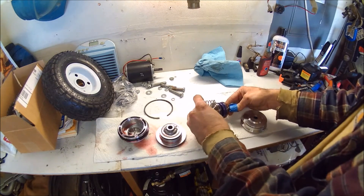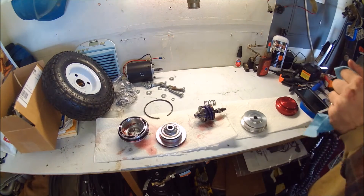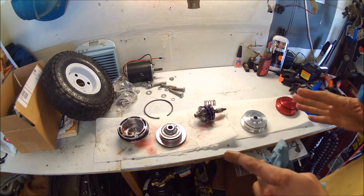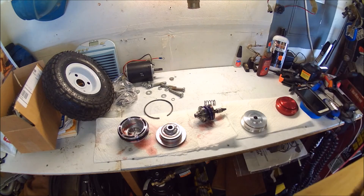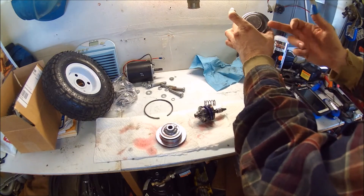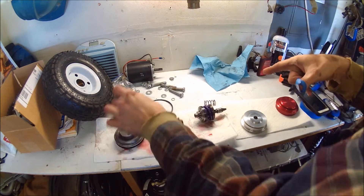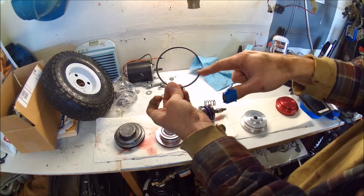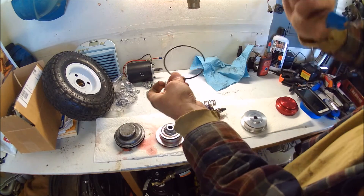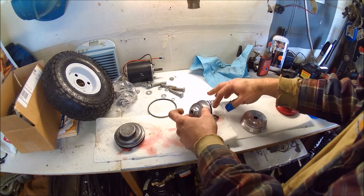The instructions do say that if you want it to bang the hell out of these gears, they've got a spacer to replace that spring. I don't want that — I just wanted it to grab harder. The trick to getting this guy off: this is the part we were pointing to on the side of the transmission. Put a pry bar up in there, push it in, then grab the snap ring. Once I pushed that in I was able to spin it a little bit, catch the very end of it, put a little screwdriver in there, and it pops right up. The piston goes on top of there like so — that's the whole assembly.